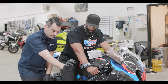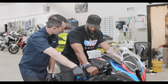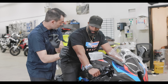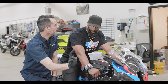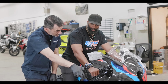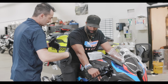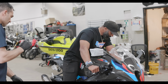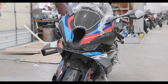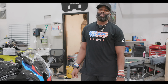Getting that lever down just a little bit further helps you fully close the throttle and then get to those brakes and bring it closed. So you ever had a problem where you're about to stop and you're like, oh God, I'm still on the accelerator, because you're still reaching up with your hand to get over the lever? When you move that lever down just a touch, not too far, but straight, boom, you're over the lever, your throttle's fully closed, and it just makes things a little bit more comfortable. The little things they don't teach you. Those little things are very critical. You didn't teach me that in level 1. I'll teach you, for sure. You ain't gonna be level 1 long, I can tell you that.